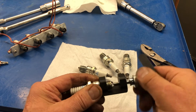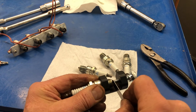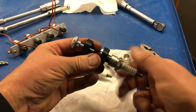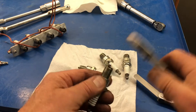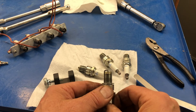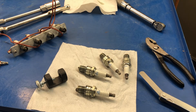These ignition systems are very durable, they work very, very well, but they only put out so much power. And that one is done already. So isn't that nice? You don't have to stand there and bash it on the table or bash it with the pliers or ratchet or whatever you happen to be using. Very nice controlled method to do that. And I'm happy all these spark plugs are gapped at 0.018 inch.